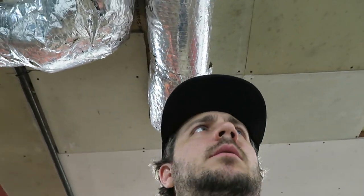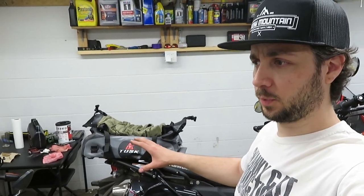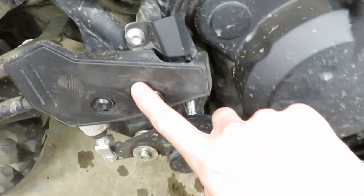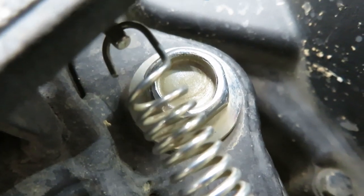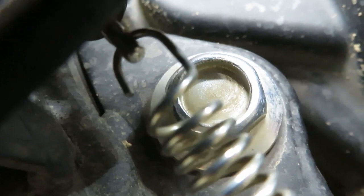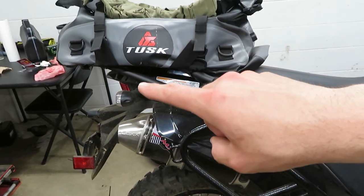Something I noticed the other day that could be a problem: my rear brake pedal was continually actuating the brake light. I had to stretch my spring out. Under the small cover plate there is a small amount of adjustment — you can see some threads sticking up. Essentially that changes the distance this piece has to travel to pull down on that little piece of metal that turns on the brake light. Definitely something to check — you want to be able to flash that brake light at people so they don't rear-end you.